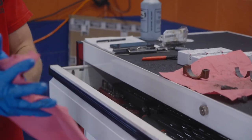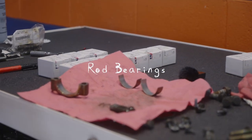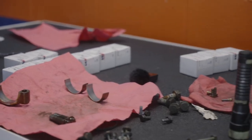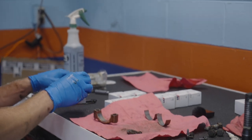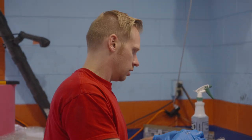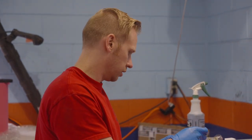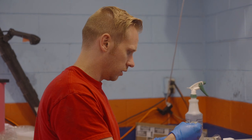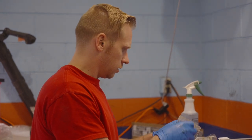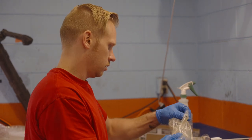These have probably been replaced at some point. These are the rod bearings themselves — it's a common wear failure item on these engines. So it's a good idea when buying one with unknown history to go ahead and replace them so you don't run into issues. You got a safety surge. Yeah. Good job, buddy.